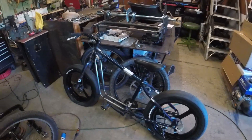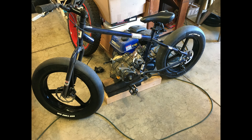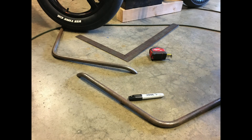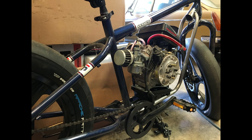Backing up a bit — we cut out that down tube and mocked up a 79cc engine to see what space we needed inside the frame area. Once we determined the space needed, we bent up new down tubes, mocked them up, and put them in the frame to create more space for the engine. It actually gave the bike a pretty nice look.